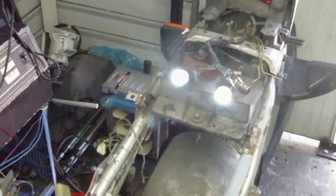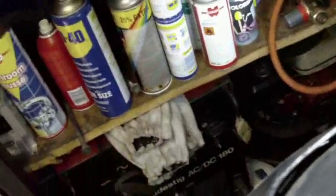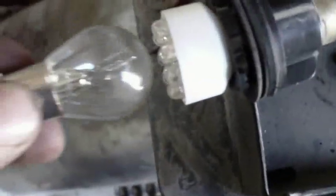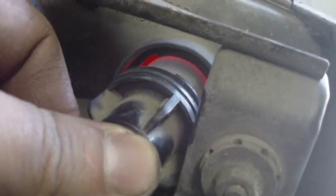Just doing a quick shot — turn the key — so that's our parking light, and if I pull the front brake, there we go: brake lights. If we look at the headlight beam here, you can see it doesn't dim at all because we are drawing far less power from our battery. This would be a good idea for any vehicle — car, bike, otherwise. Because these LED fittings are slightly bigger than the normal filament bulbs, they are not going to want to fit back in here, so I'm just going to get a file and give that frame a touch and hopefully that will be it.